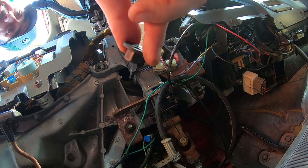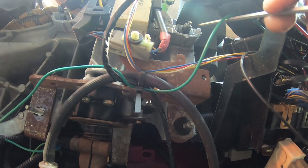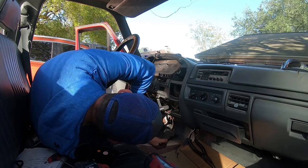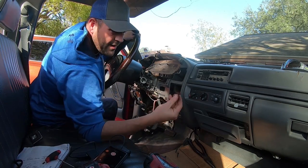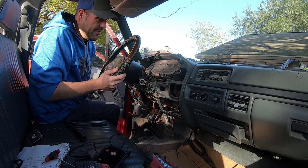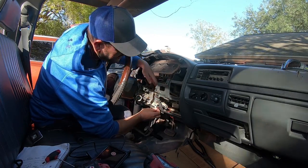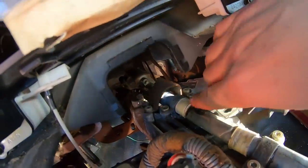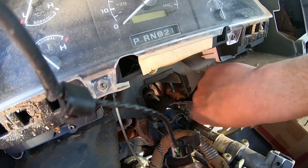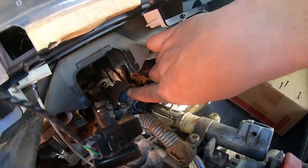It's just going to be one of these nuts with the washer attached — we're going to take out four total. On the right-hand side of the steering column we need to take this one out, then move up to the last and fourth one. Now off the shifter selector, I'm going to have to undo this wire. When I say this thing snapped — if you can look right there — that's where the shifter tube snapped in half. These little bushings are supposed to go underneath these conduit straps; this one slipped out but it's supposed to be underneath here.